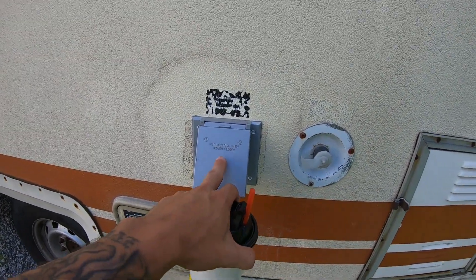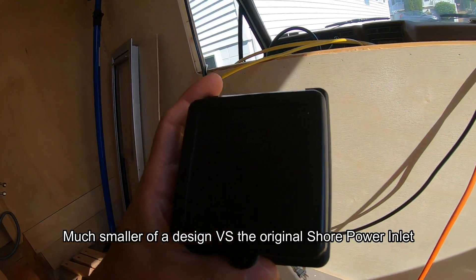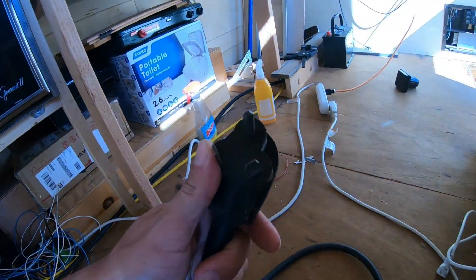The original service was up here but the hole was so large — roughly like a five inch hole for a two inch socket — so I had to get a bigger plate to cover that up. Here's the 30 amp service plug for shore power. I'm going to reuse this plug right here; that was the original plug to Chappie. It came with roughly 30 feet of cable and it is 10-2 wiring and it's stranded, so it's exactly what I need for the job — money saved.